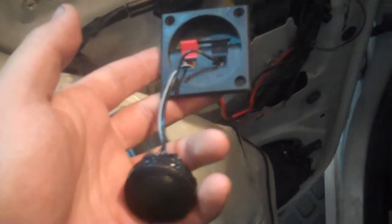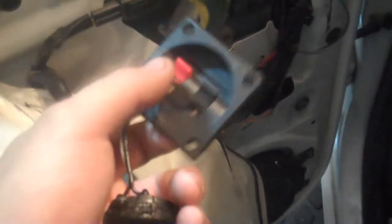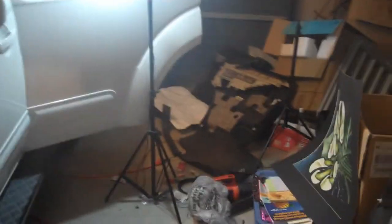What I'm going to do is wire this through the door and then plug it into the terminal, so that when I take the door panels off I don't have to have butt connectors on there and break them off — I can just unplug it and plug it in whenever I want. I took off the quick connects because I couldn't find any small male connectors, so oh well. This is what it's looking like. I turned them on last night, and the two front door speakers alone — when I only had them working — were louder than all four of my door speakers. I walked out into the street and the whole neighborhood could hear them. They're getting pretty loud already, and I'm just going to tune these and then I'll make a video later.